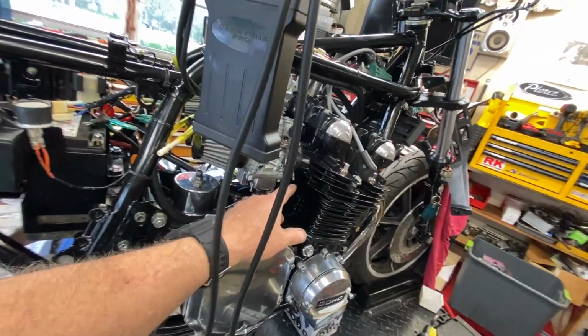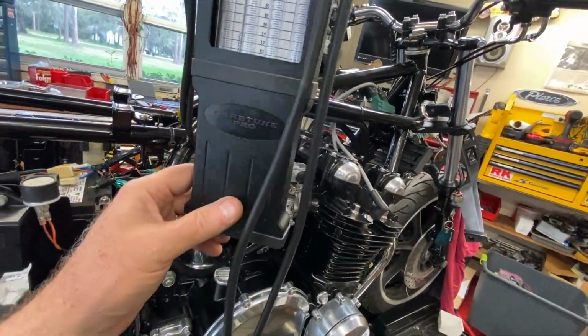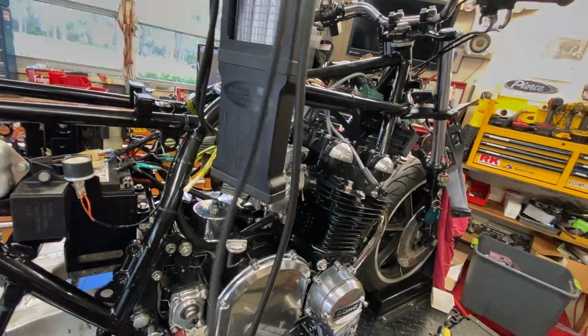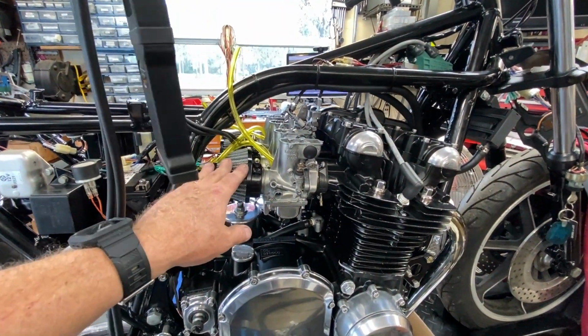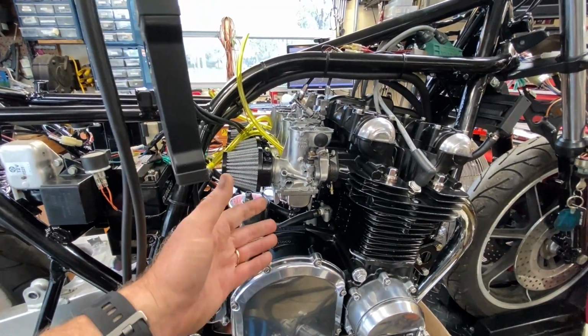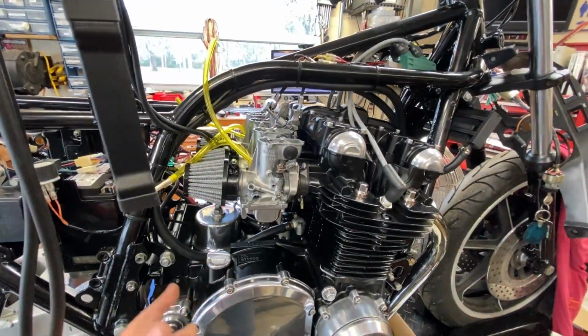I just went direct into this with number 4, and it was shooting up like crazy, so I don't want to damage my carb tune either. I'm going to try that tomorrow, but I've got to take the carbs off first. I'll do that off camera and try to find out if something's wrong inside with the settings, the float levels and stuff. That way I can get an idea what the jetting is too. I'll read the jet numbers and then put it back together.